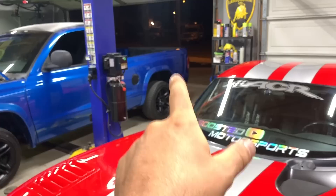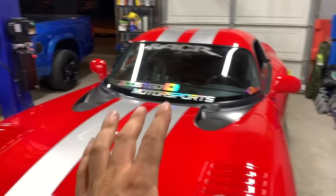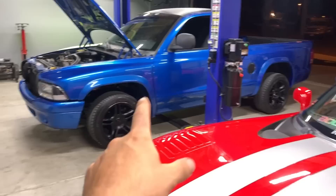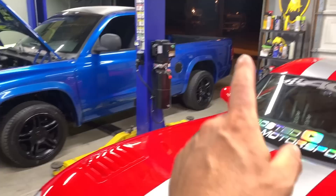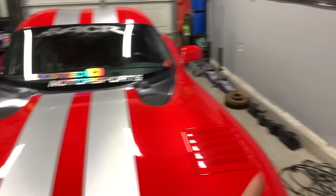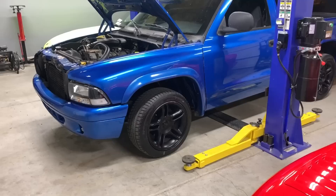The plan is to chop out 4-inches in the back — it'll look way, way better. But we have to come up with a solution for the front. If we lower the rear of the truck 4-inches, supposedly — and maybe somebody in the comments can confirm it — I have to find a set of springs for the front. They don't sell or make drop spindles that I'm aware of, so we have to do it with springs in the front. There's either a 1-inch, 2-inch, or 3-inch lowering spring available for the front. I'm thinking we drop the rear 4-inches, drop the front 3-inches, and that should get us sitting decent. If you guys see 4-inch lowering springs for the front, drop a link in the comments below.